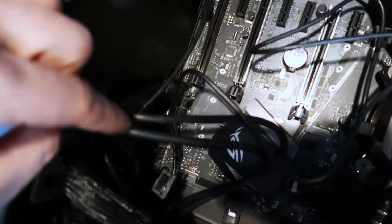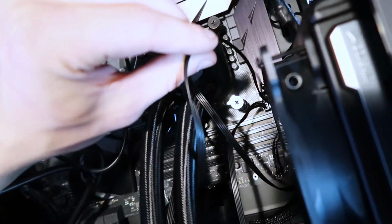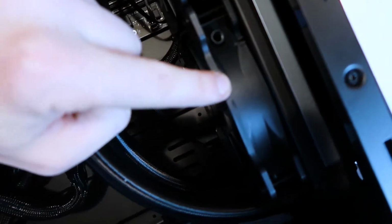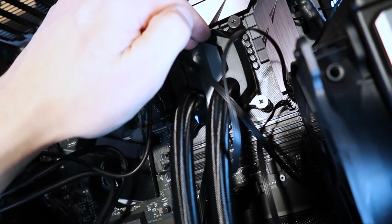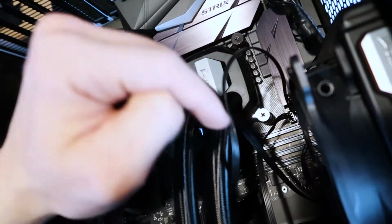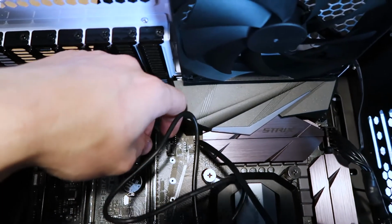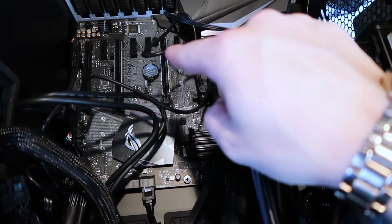Plug this up to one of your USB ports. As you can see in there, you got a USB port. It's plugged in. And then take your cables that come off of your fans and off of your cooling unit on your CPU. And you plug those in. CPU to the CPU, one of them to the optional, and then the other one you can throw over here to one of these chassis fans. Now that all that's plugged in, we're going to go for the graphics cards.